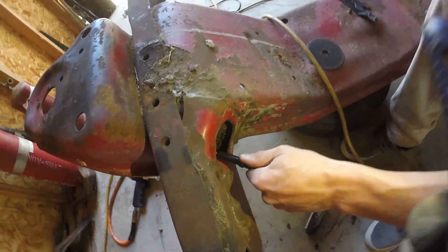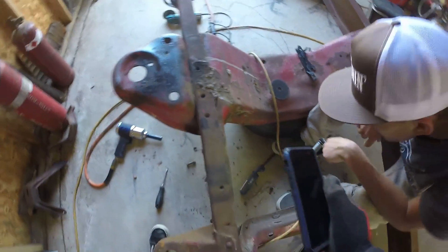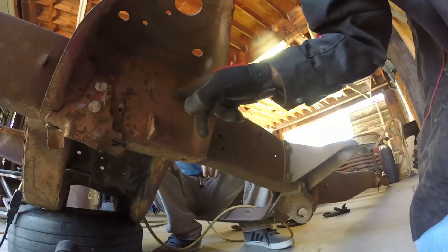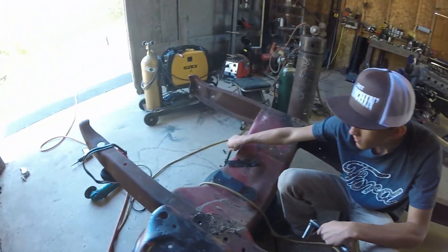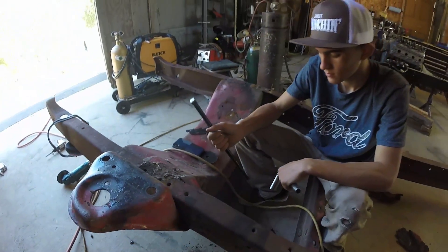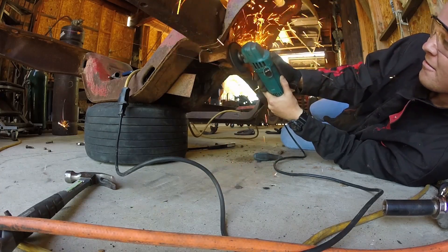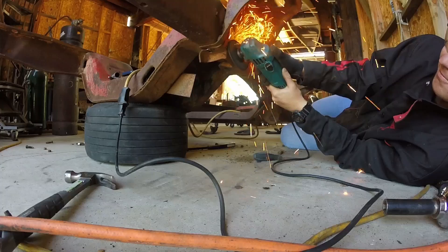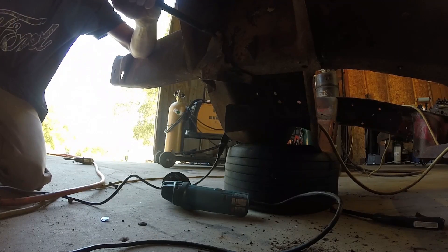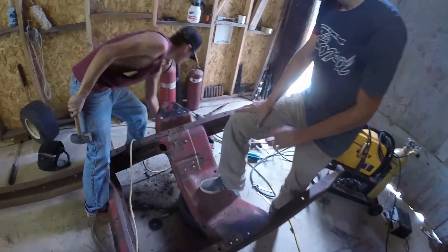Update — there's actually a nut down there underneath all that stuff, so we will get this out a little bit easier. Our two bolts on the bottom are out, so I just gotta flatten these down with a grinding wheel and then hit them with a drift punch. We're getting old-school. This is gonna suck — we're gonna have to punch these things out the old-fashioned way. Grind it down a little more — it's not even moving.